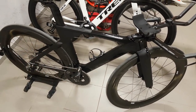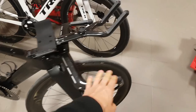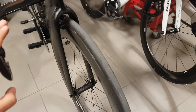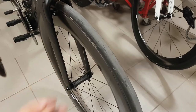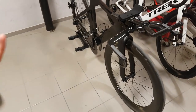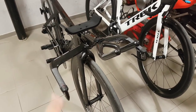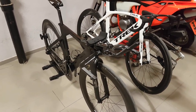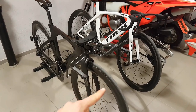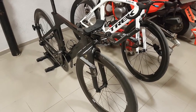The setup needs to be very fast but also light and stable in the wind. The MV 7.8 is tested as the fastest spoke wheel, and according to many sources, on bikes with narrow fork blades a spoke wheel is also going to be faster than a tri-spoke, two-spoke, or five-spoke, because you have less of an effect of those large blades suddenly passing through an empty space between the forks. The 7.8 front is light, super fast, and extremely stable in the wind — so that's my front wheel candidate.